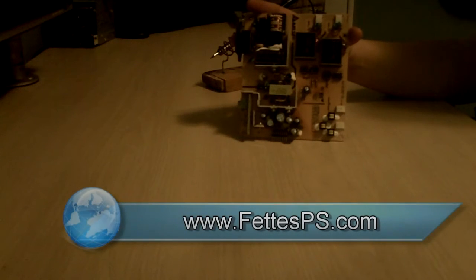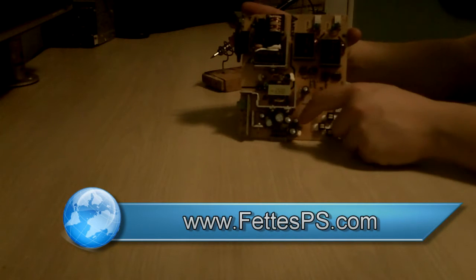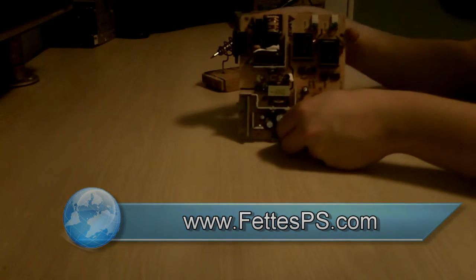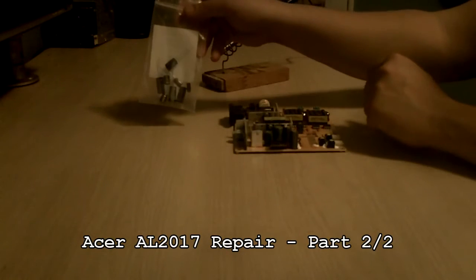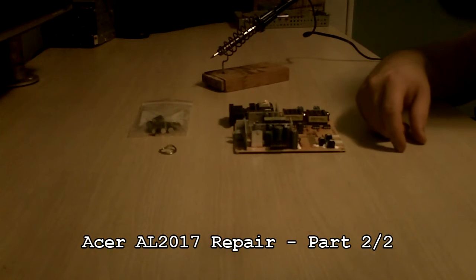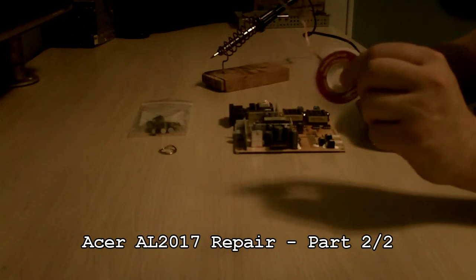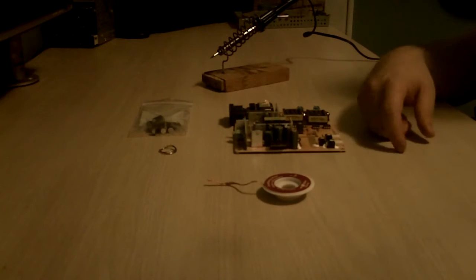Once you've extracted the power inverter board, put everything else aside and we're going to go around and desolder all these capacitors. Right now I've got my soldering iron heating up. I've got my kit here with replacement capacitors. There's a little ring of solder they threw in. I've got a desoldering braid here. If you've got the pump, by all means use that — it's definitely preferable.